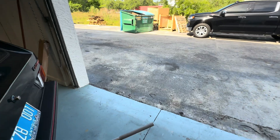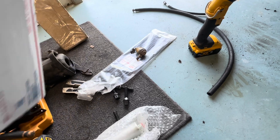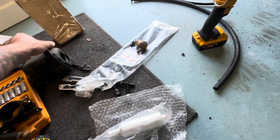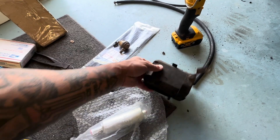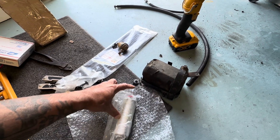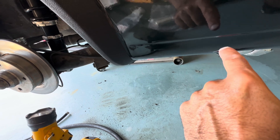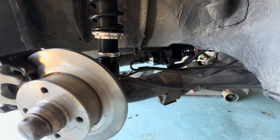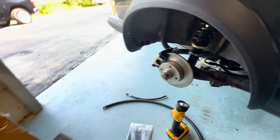Still the same video — I was gonna end it but I figured I'd save it. I'm back at my shop and I received the fuel pump from Walbro directly. This is it right here, and there's another thinner fuel pump but I assume that's my old bracket. I'm gonna go ahead and put it in here. It comes with some barb fittings so I'm just gonna do barb fittings on the pump, remove the old pump, go barb, then change the AN fitting that runs up to the fuel filter and put a barb in there so I can change the line.